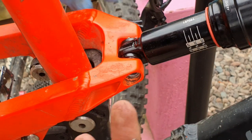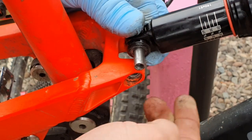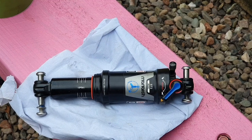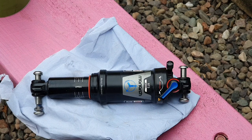There's a shaft and a bolt — I'm just gonna pull it out and for the time being put the shaft back in, bolt back in, so I'm not gonna lose anything as I move it over to the bench. Here's the shock assembly away from the bike, just so you can see it clearer. You can see the through bolts at the bottom end and the top end. We're gonna take them out, we're gonna clean them. How you clean them is up to yourself but usually alcohol or a degreaser is good — I use these alcohol wipes, industrial type stuff from automotive factors like Halfords or local hardware stores. So I'm gonna take the bolts out, lay them out, and then clean them.